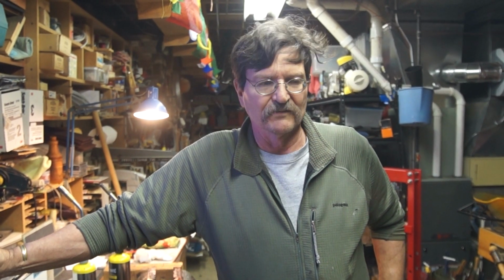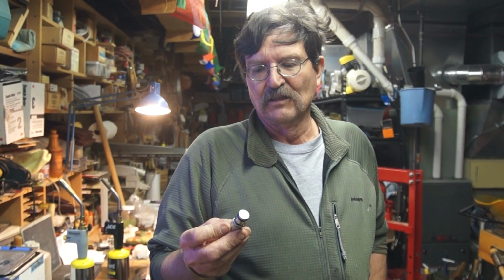With the aluminum hubs, I think the rule of thumb is you don't want to take them apart unless you have to, say to replace the bearings. I recommend that if it's a new bike to you and you don't know the history of it, you should take the bearing stack out to inspect it, make sure the bearings are good, check the preload, re-grease them, put them back for peace of mind. After that, the near side bearing can be taken out, you can R&R it. If you pull the center piece with the wedding band in it, this can go in the other side and you can grease it. And you should be able to get by for quite a while.